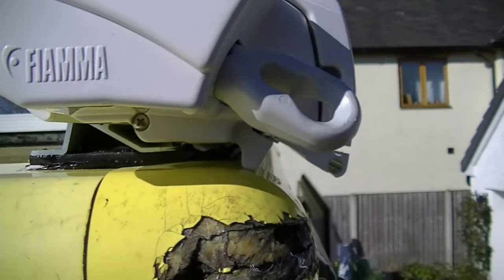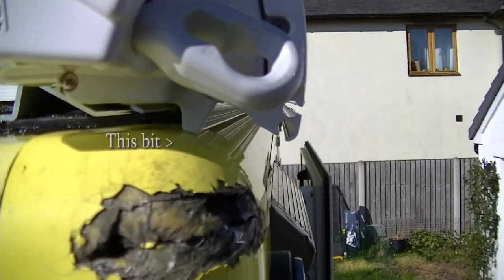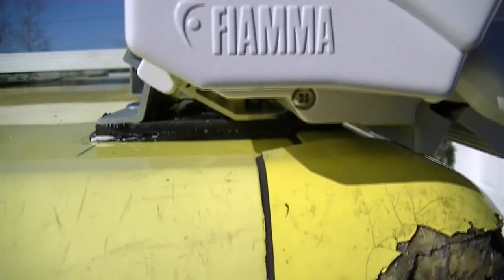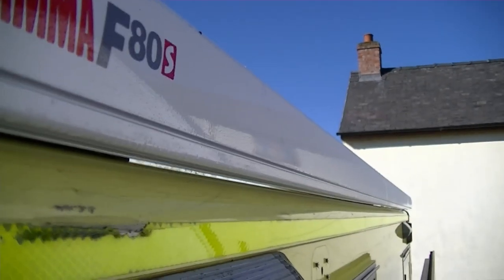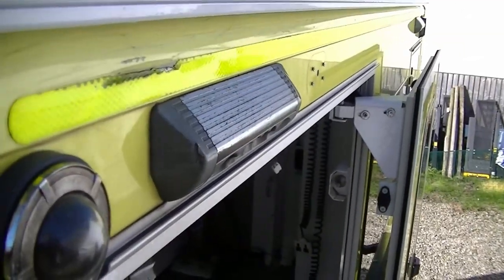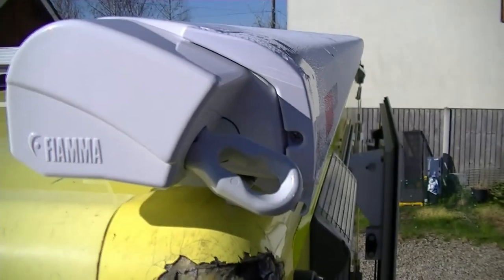So hopefully this will focus — you can see that metal protrusion there. It's just touching this corner piece, which has been damaged and needs to be repaired when I get this van painted, probably next year. That protrusion doesn't appear on the F65, and that meant I had to space this up very slightly. You can see the mounted brackets — these are universal brackets designed for flat roofs — a bit of plastic and a bit of Stockboard as well. There is actually a slight gap, and the actual awning itself is pretty flush with the roof. I didn't want to go for one mounted on the side like the F45, because I want to keep all these lights. And the F45 wouldn't have fitted on the other van anyway, so it had to be this model or the F65. They've lowered the profile — it's supposed to be more aerodynamic.